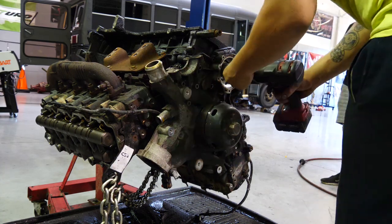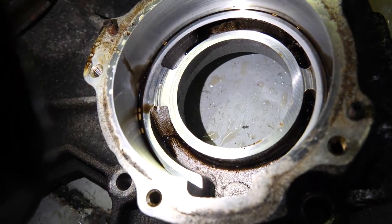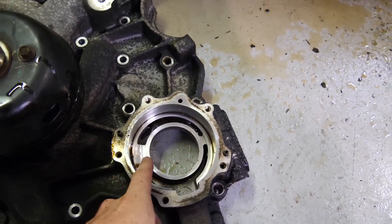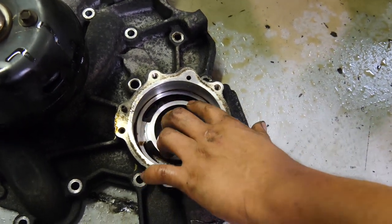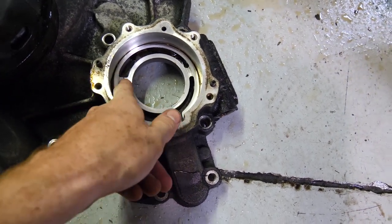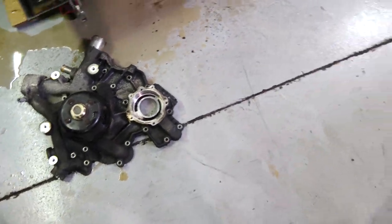There's a gouge out of that. Is that the oil pump? The low pressure oil pump. So this surface is actually how it seals and builds pressure. Yes. And if there's a big gouge out of it... some of this stuff here is just from metal on metal contact, that's not a big deal. But that's bad, because instead of building pressure, all the excess oil would just go through that hole.